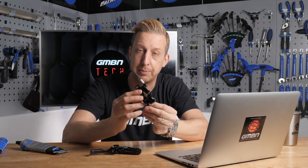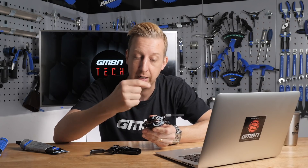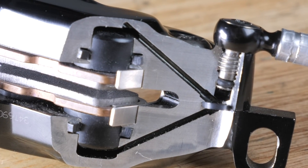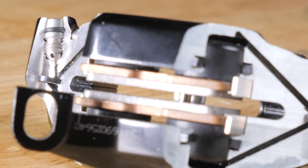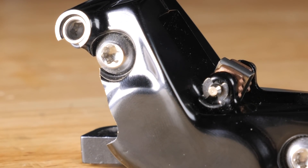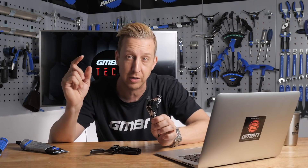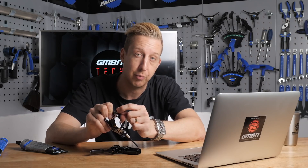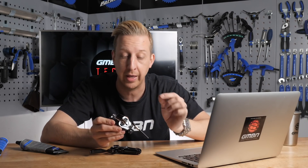I've got a brake caliper here - this is a SRAM caliper with a cutaway so you can see the inside. This is the bleed screw end, and this is the banjo, where fluid transfers from the system into the caliper. You can see the pistons and the bleed channels. Now, if this banjo bolt - on this one it's a Torx T25 - is even the tiniest bit loose, even not enough for it to move, air can still get in and tiny bits of fluid can still seep out. We're talking enough that you'll barely notice, but it's enough for the master reservoir to just drop slightly, leaving a void inside. The same applies if the bleed screw isn't put back in properly, or if you've popped the pistons out by mistake and damaged the seals - damaged or perished seals can let air transmit through there and oil can get back out.